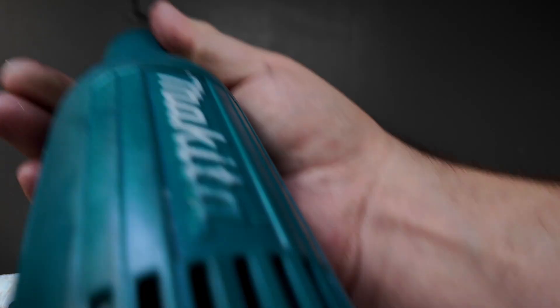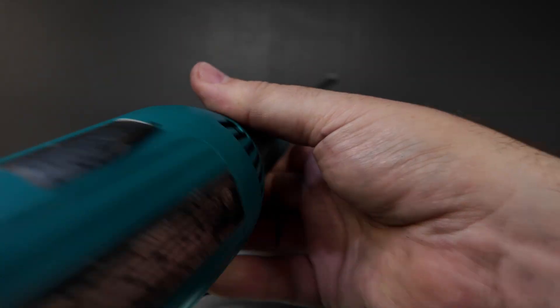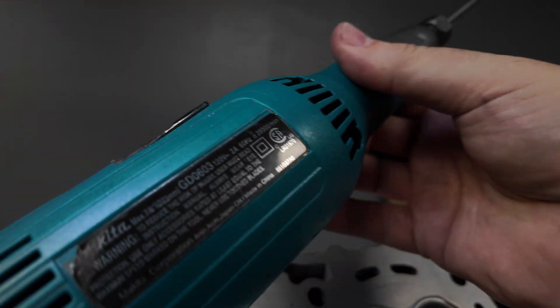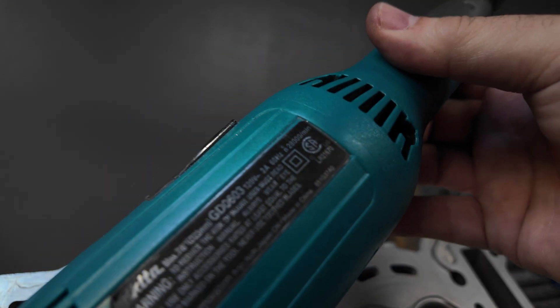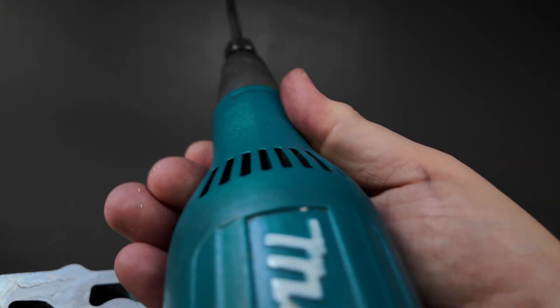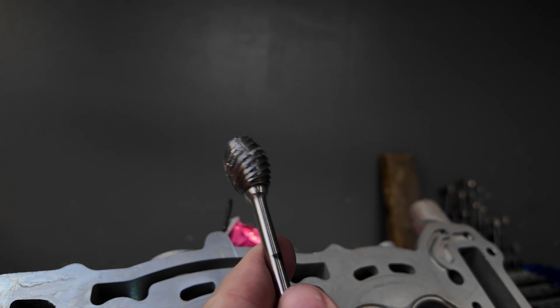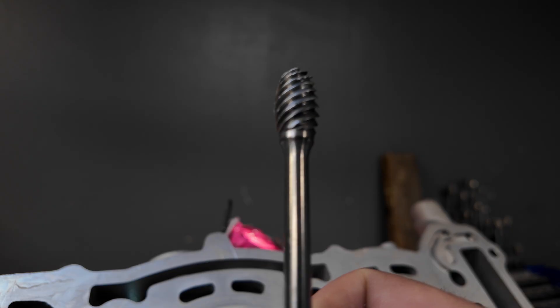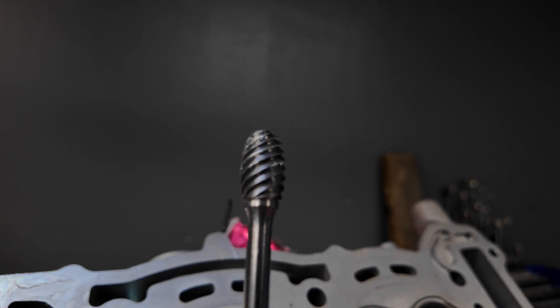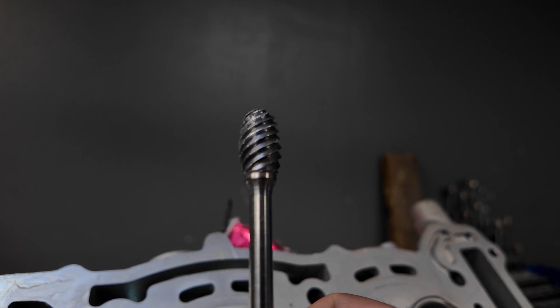I need something that's just going to rip it right out, and this thing's going to make short work of it. I'm going to be putting it on my Makita GD0603 grinder. I think that Makita should be sponsoring these things since I'm showing so much with their grinder - I'll put some links below. These burrs are available on our website. You'll also see me go back over it with the Head Games Super Spiral half-inch burr, and that's just to make everything nice and easy to sand. So once I rip through the intake side, you'll be able to see the exhaust. Let's go.